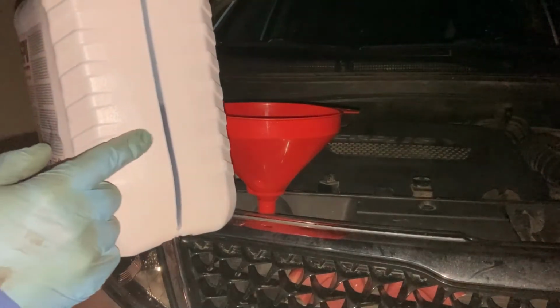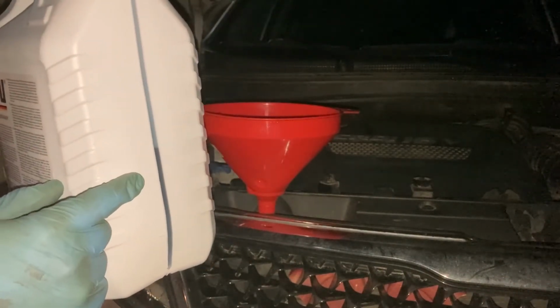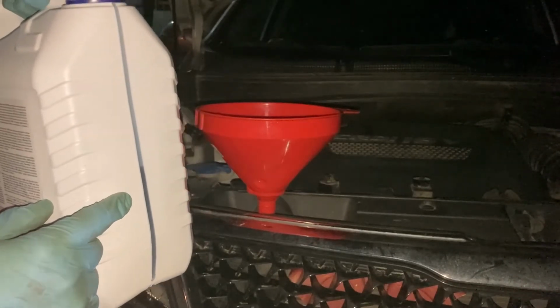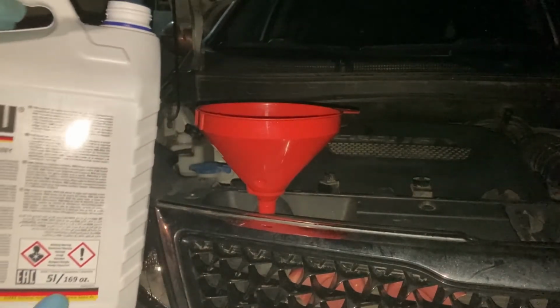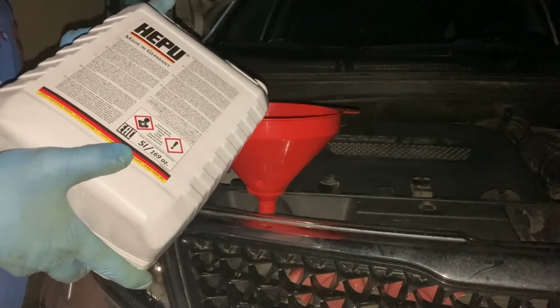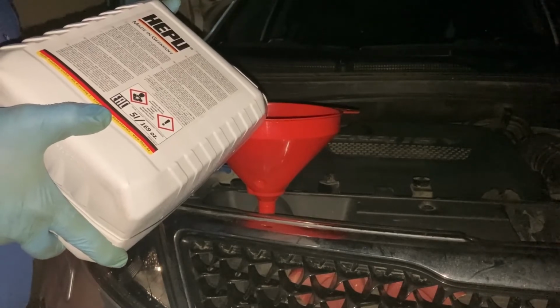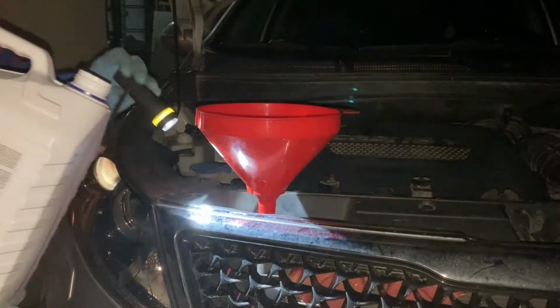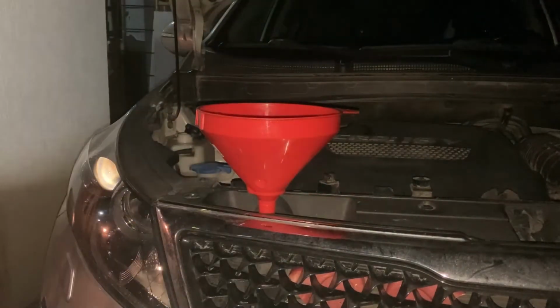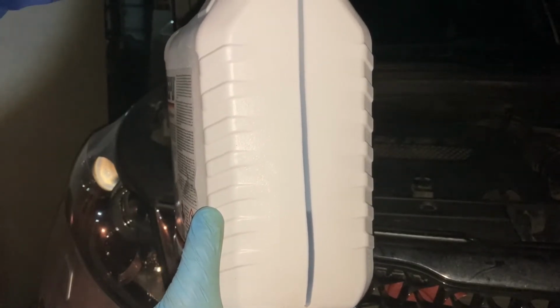And when you get near the 2-liter mark, meaning that you've added 3 liters, start pouring even slower, and keep an eye out for the top of the radiator, trying not to spill any of it. Because as I said in the beginning, this thing is based on ethylene glycol, which is extremely, extremely toxic. And the radiator is right now full, and this is roughly the level, so about 3.1 liters of antifreeze got in.